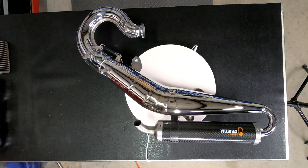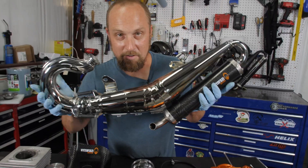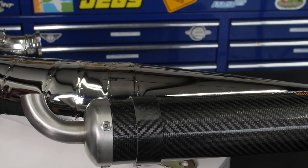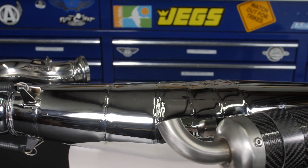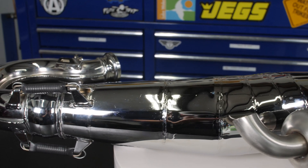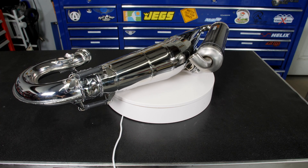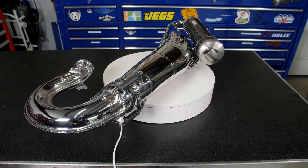This is the most standout piece that exists on the Factory R — this is what everybody loves. This is the exhaust. A little bit shorter on the silencer. Instead of using stamped pieces, they've used a cone pipe type of style where there are all these rings welded together, instead of just one solid stamped piece. So these are really finely tuned exhausts — these things are awesome.